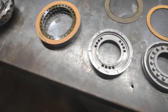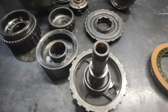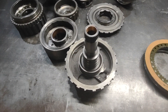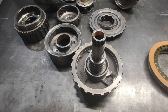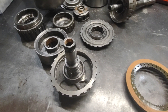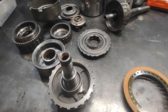That's a little quick class on the major differences and why the strength is different. Since one of my guys asked it today while I was showing him differences on some builds, I figured I'd grab enough parts to make a little educational video. The turbo 350 I'm really comfortable with to the 750-800 horsepower level. Above that I'd usually like to see a turbo 400. But if you're already running a 350 and don't want to go through the process of changing everything, keep pushing it — I wouldn't be terribly scared of it even at a thousand or more depending on the weight of the vehicle.